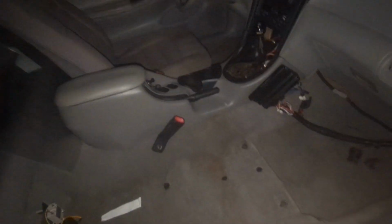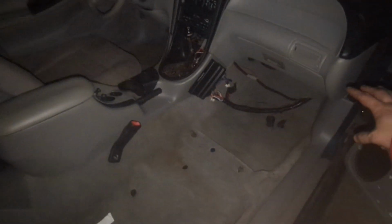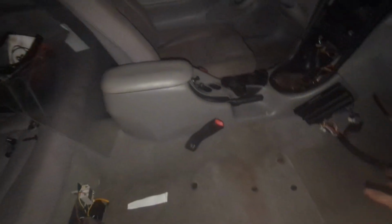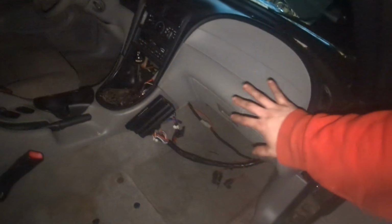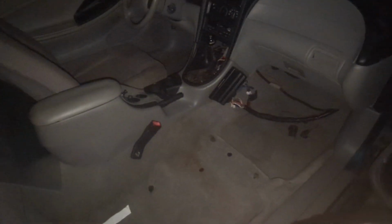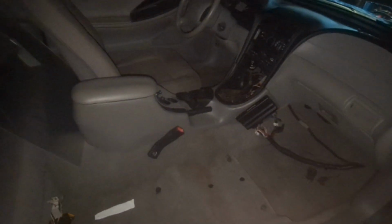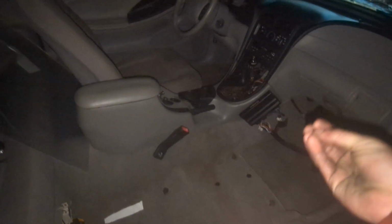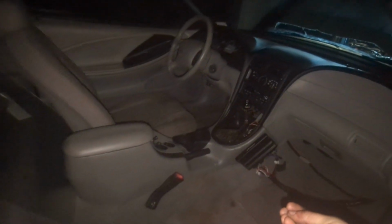Try to do stuff like that, and then to simplify the car, this thing has a huge wiring harness that just goes everywhere. When I pulled pretty much all the interior out, everything behind the dash more or less stayed the same. But anything under and back, I ended up cutting out. Snip, snip, any wire that wasn't needed, I got rid of. I didn't have like a super fancy method of doing that. All I really did was pull the whole harness out, kind of trace the wires, see what went to where.